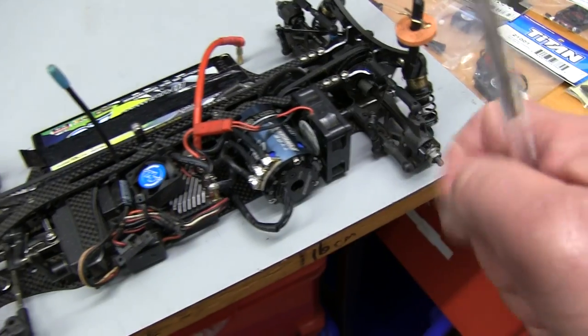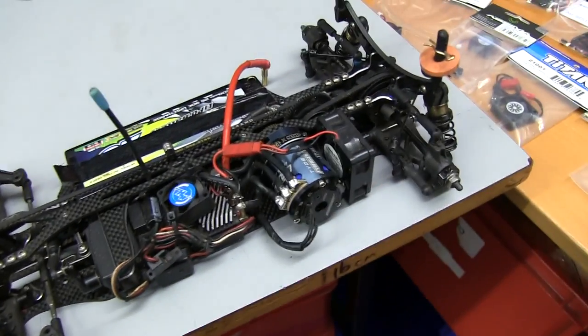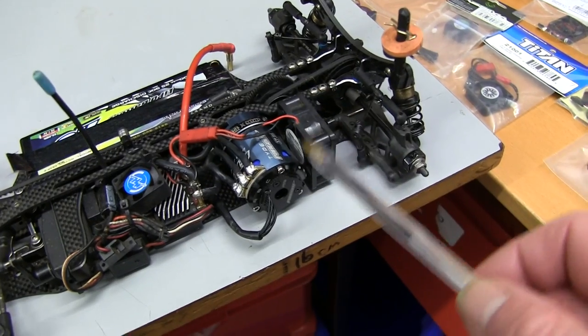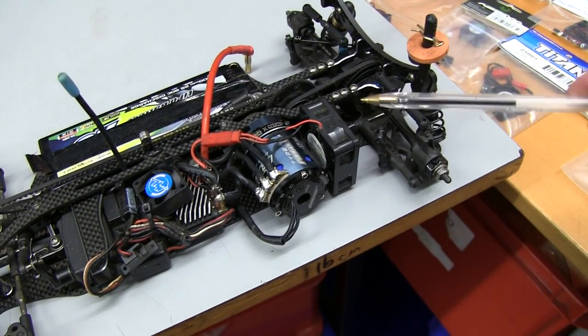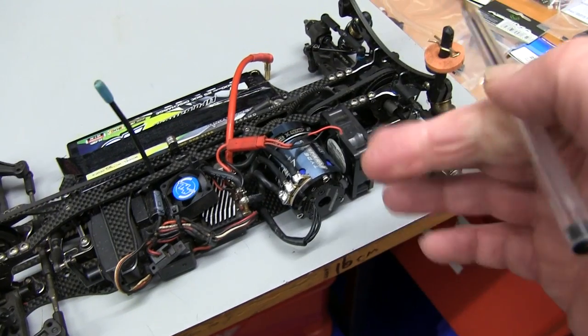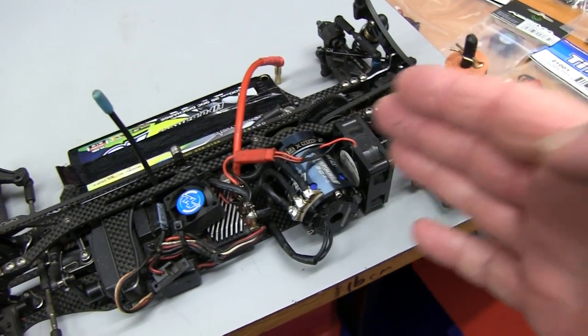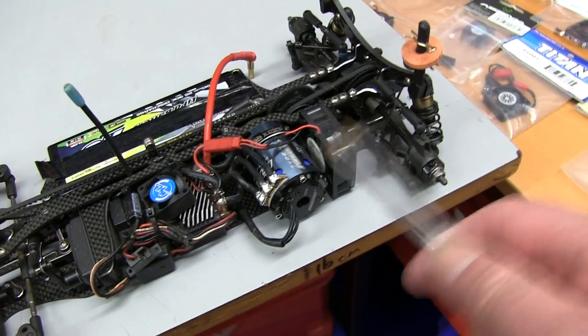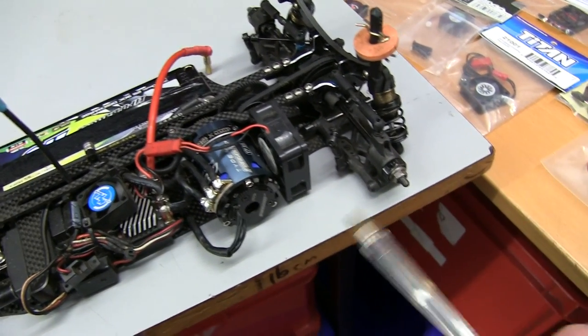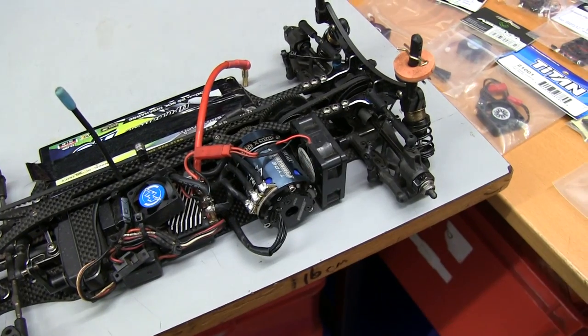Should you use a shroud? Some people put shrouds over the motor. You've got to be careful with that, because you'll stall the motor. The air's got to go across the motor and out. If you block it in, you get a back pressure and you won't get much airflow, and the hot air is going to stay inside. I don't like shrouds, some people do. I prefer no shroud and a really good fan.